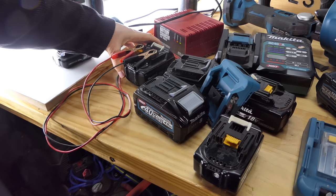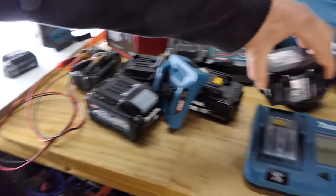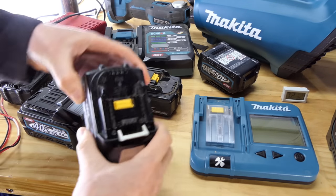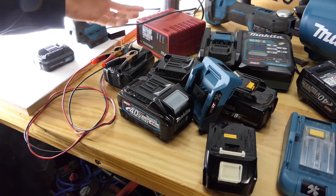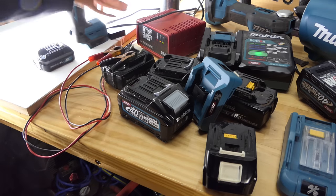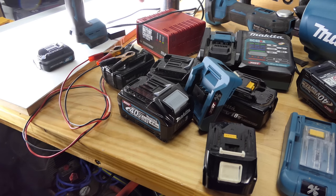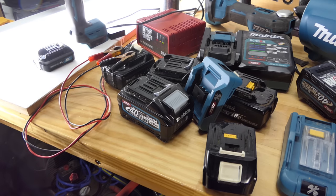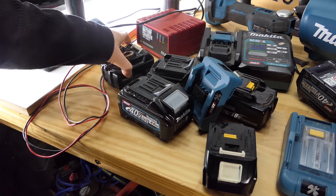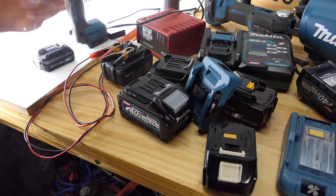Interesting. Now, is there anything else I'm going to do to this battery? So I could try that jump start method where I hook it up with one of these other batteries, i.e. put the battery on the charger, a couple of wires coming out of the terminals going over to this battery to charge this, but even if it works, it'll probably only work once. It's not going to let the charger charge it by itself. It's just not worth it, and I think that there's a cell stuffed in the middle anyway, and if that cell is corroded or in some way compromised, it's dangerous. Could end up catching on fire, setting your house on fire. Not really worth it for a stuffed old battery that wouldn't last much longer anyway, because the other cells aren't reading much either.